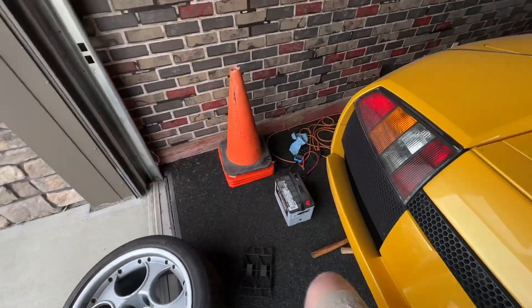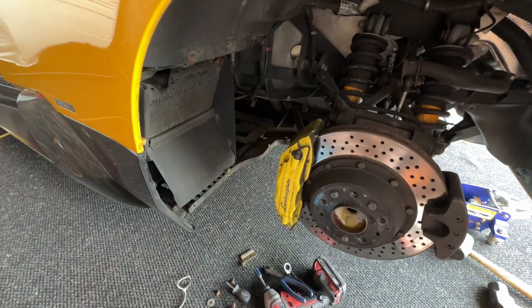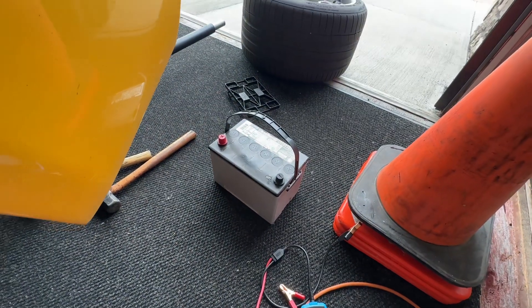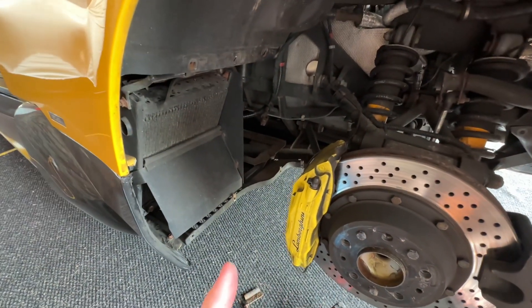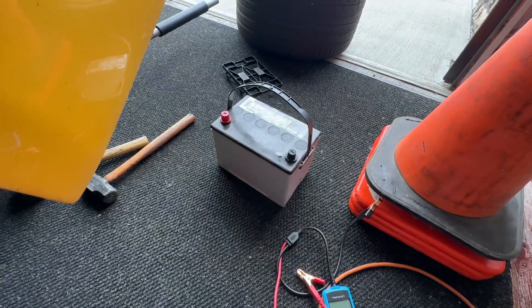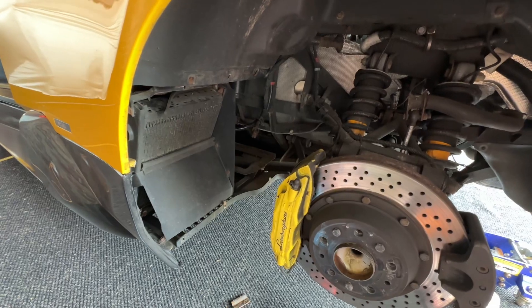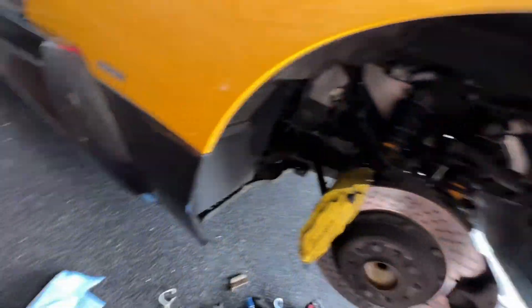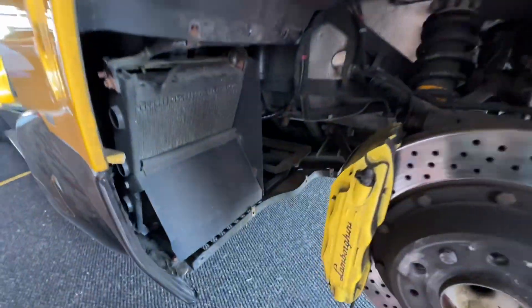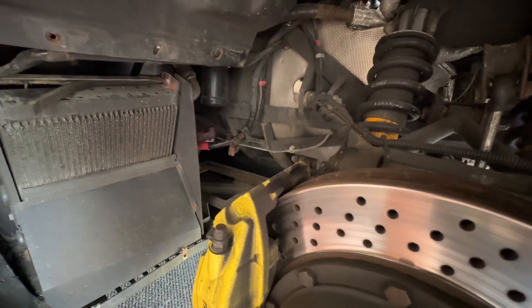Many stores later... Where should we put a battery? I don't know, maybe an easy-to-service, accessible location like by the engine? Italians. Maybe the wheel well is good — we didn't really think about all the extra room. Anyway, I've got a battery. It's a 34 non-R; this car is supposed to have a 34R. I believe I could make the terminals and things fit, but I bought the wrong battery again. I had to go to a few different auto parts stores, but luckily the regional NAPA distribution center had one. I'm going to slam it in there after I bottle-brush the terminals. I cleaned them up quite a bit already with Fast Orange, which is pretty abrasive. Happy enough with how all that went down — we'll jam the new battery in and see how the car behaves.